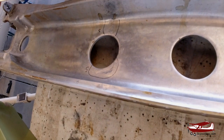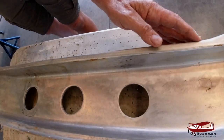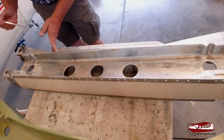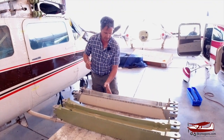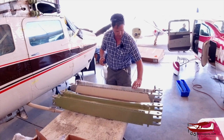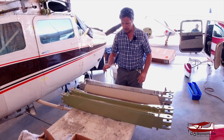And also along here, you can feel irregularities. After you've sanded it and cleaned it to get all of the glue off from the headliner and the interior trim, when it's clean, you've got certain tolerances along here. You've got different thicknesses. You've got to make sure these are all exactly right. So this one failed.